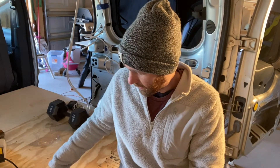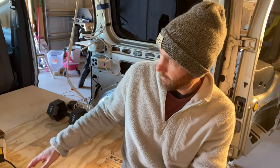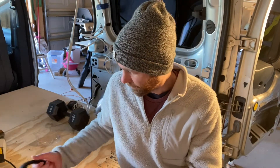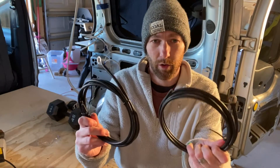You can see more about that part in the other video. Down here, what we're going to have in the van is it comes with this charge controller. This is a smart MPPT 20 amp charge controller. Probably could have gone with the 40 amp because my Renogy battery can take 30 amp charging voltage, but sometimes you got to go with your budget. Solar is kind of a backup for us - it'll help us out and it fits in the budget. It comes with two cables to come out of the charge controller to go to the battery. They're not color coded, so you might want to label those.